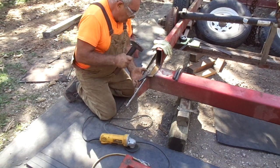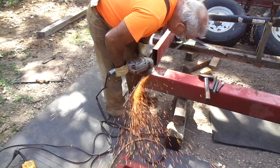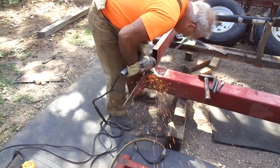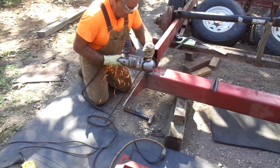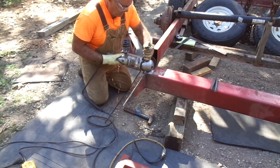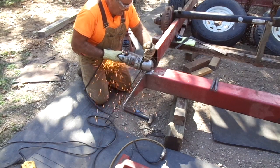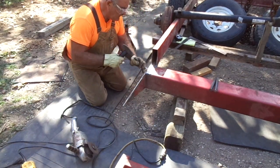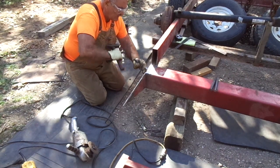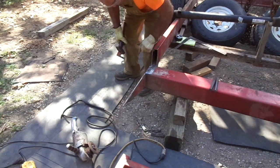The big thing we're going to have an issue with is deciding where to stop. We're thinking about possibly putting a butt joint right there where I'm grinding right now. But as we got farther and farther along, realizing how thin that material is and thinking about the stresses that's going to be on that particular joint whenever we go back — it wasn't until the end of this video that I actually decided to more than likely change everything in the subframe and go with heavier quarter-inch material. We were still taking care and making sure that we didn't do any extra damage, because when you take things apart, you want to take them apart with the intention of possibly reusing them. We usually run on a tight budget; I don't really have an excess amount of money laying around to buy parts and pieces unless we absolutely have to.